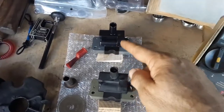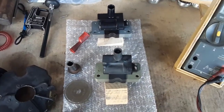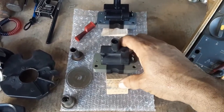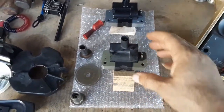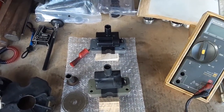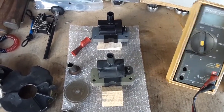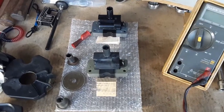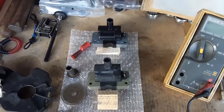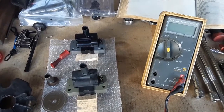This coil only cost me about $20–26, instead of $100-something for the whole distributor, so I'm hoping it does the trick. Anyway, this was just to show you how to measure the resistance and check if you have a bad coil on this style of ignition system with a distributor — the Nissan Xterra, Pathfinder, and Frontier first-gen. As always, please rate, comment, and subscribe, hit the bell notification, and I'll catch you on the next one.